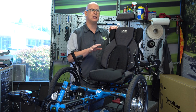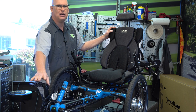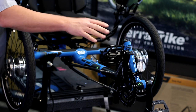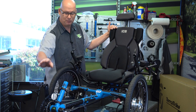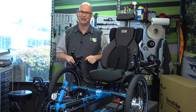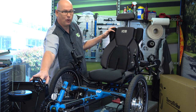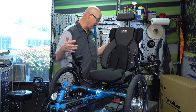Another cool feature is that on a lot of trikes they can adjust for the size of the rider, but they don't change the crank length. On this one, rather than running a 170mm length crank, they are shrinking it down probably closer to 150 or 155mm. It is a lot shorter, so that when you're pedaling your knee doesn't come up and hit you in the chin. They shrunk down the cranks, they shrunk down the seat, and even the length of the trike is shorter.